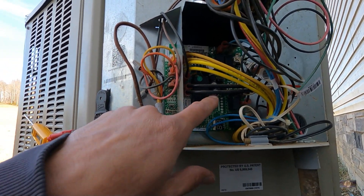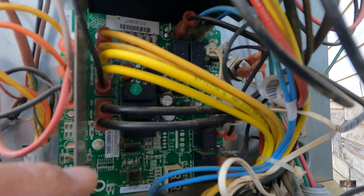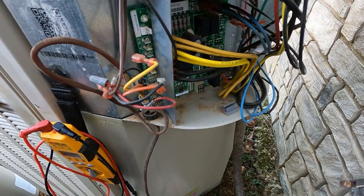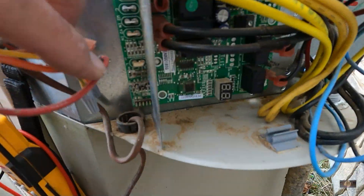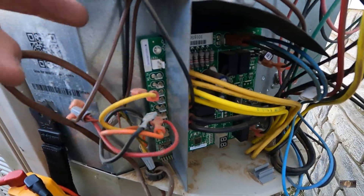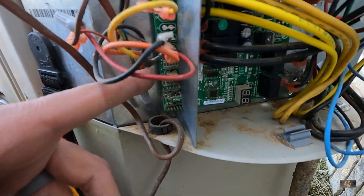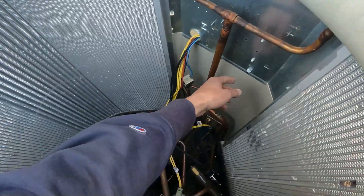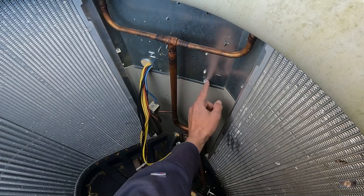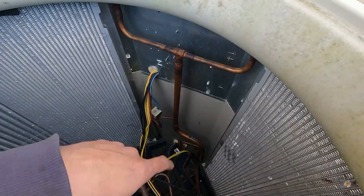Just wire for wire on these things. This one is a little more updated — it's got some putty-looking stuff; I guess they've had issues with these in the past. You've got to take off the low voltage terminals and then four little standoffs. Two of them are just on the metal and the other two are hooked in and actually connected. Then there's this little tab right here that has to be turned so it can slide out of the keyway — and when it slides out of the keyway, that pulls the thing out far enough to slide the board out of there. Hope that helped somebody out.